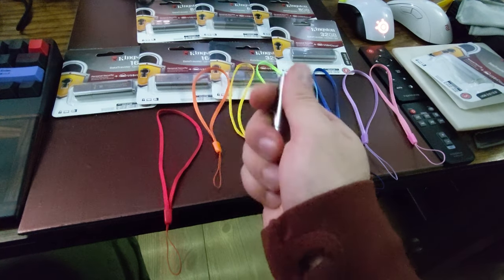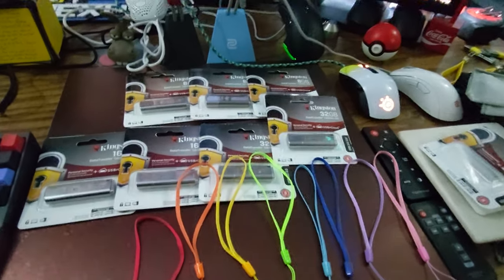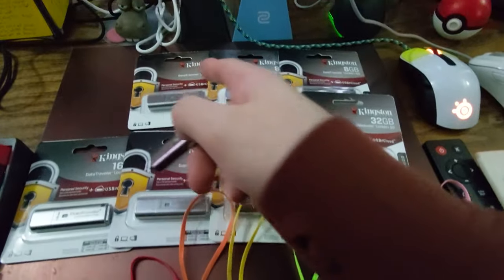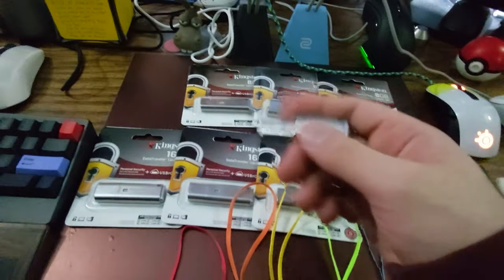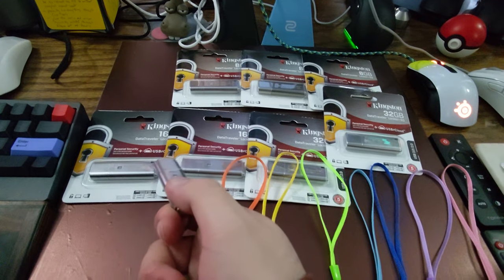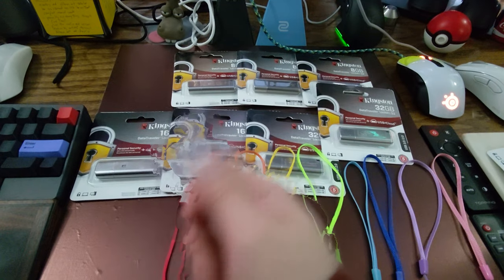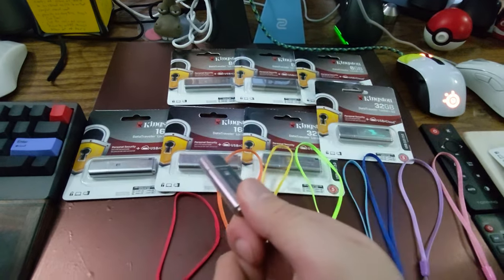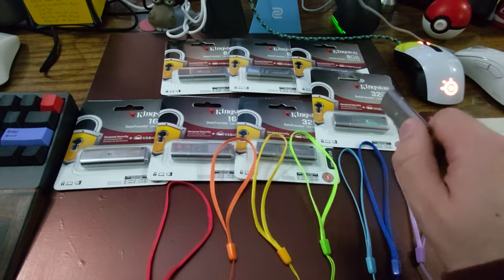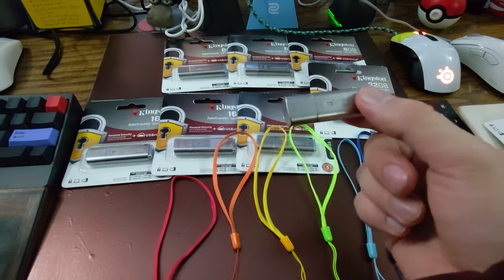These just feel freaking quality. The other nice thing is for a lot of PC repair stuff, I don't need 128 — that's giant. A lot of these are just boot drives. So I got four 8-gigs. They don't have a 4-gig; I would actually really like some of those for some older stuff. Two 16s. Windows now is bigger than an 8-gig if you need certain versions. And I got two 32s — that's the max you can do for FAT32. It is 32 gig. If I end up needing bigger ones of these, I will get them.